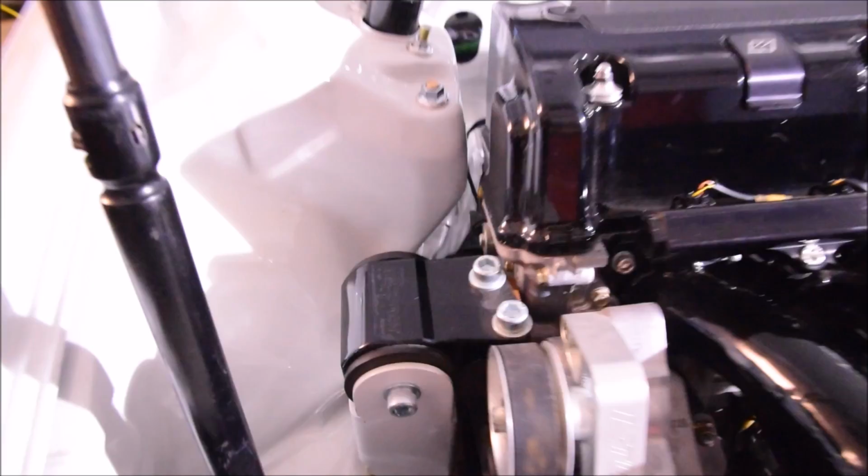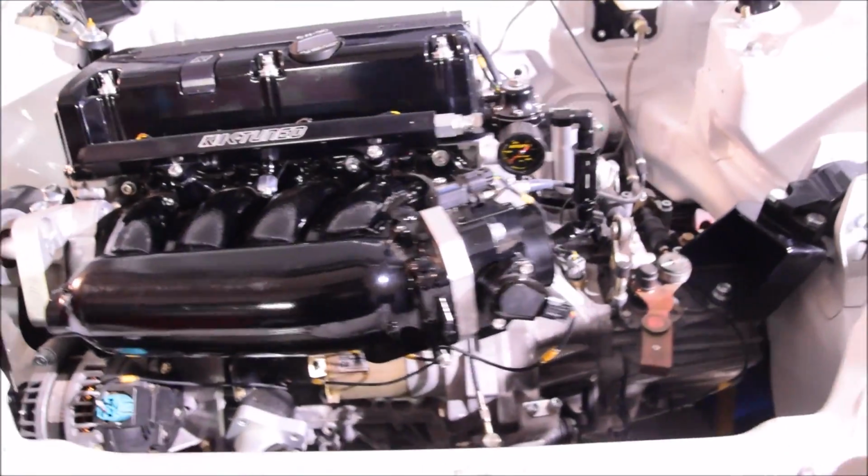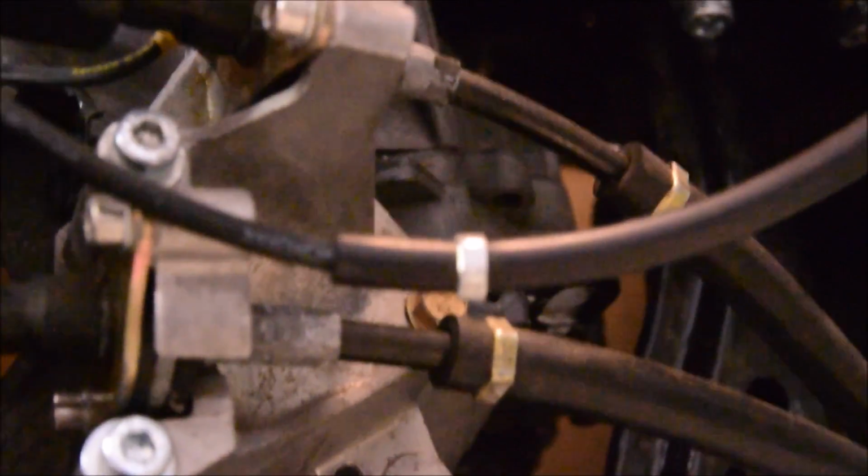We were able to hang this side where it needed to go, and then we brought the transmission mount up over here. We built this guy over here. Once we did that, then we were able to rock the engine back enough to clear our cross member with the transmission. If you could see through the cables, we're perfectly clear there.